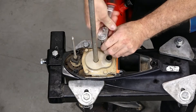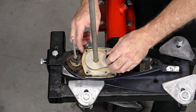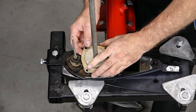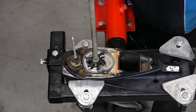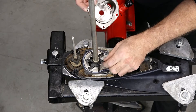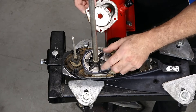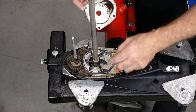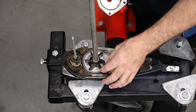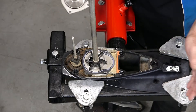Alright guys, to get this apart is really simple. We just need to remove these four bolts. After you remove those bolts, we can lift the housing directly off. Now here's something important — you see the general shape of the impeller. If there are any pieces missing, we need to find those and get them out, because chances are they could be stuck in the tube going up to the engine, or worse, they could be in the engine themselves. If you can't account for all the different pieces, chances are you're going to have a cooling issue because it's going to be stopped up.